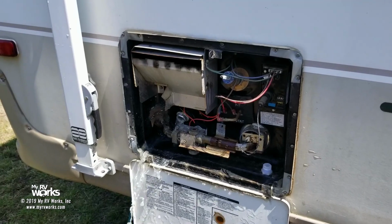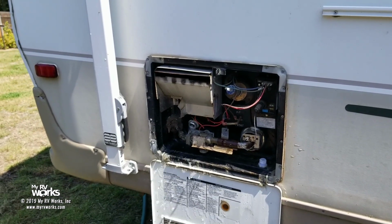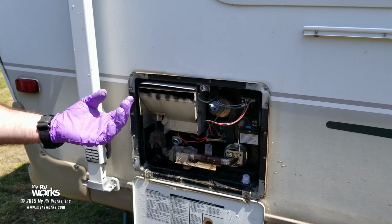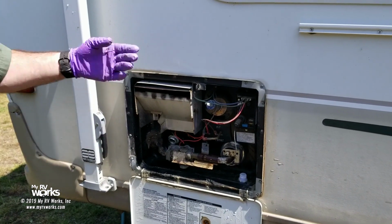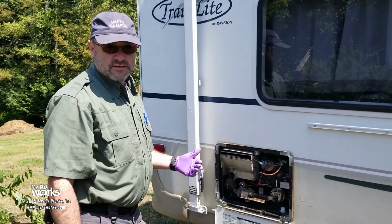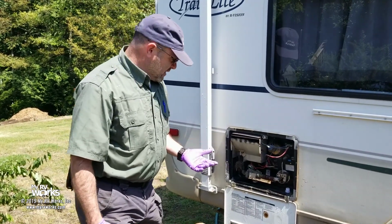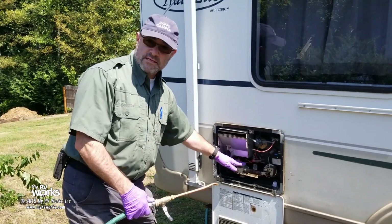Yeah, folks, I'll tell you this. The service call for this was because the toilet was not getting any water. And we came with a new valve, expecting to replace the valve because the valve had failed. When we got in there, we never even had to pull the valve because there was all this gritty sediment, not really mold from the freshwater tank, but like what we would expect to have gotten from the water heater, that had clogged up the toilet valve. So we cleaned all that out, and the toilet's working fine now. And that's what's led us to wonder, is it possible that the manufacturer connected the toilet to the hot water instead of the cold water? It's possible. And where'd the gritty calcium stuff come from that we saw in the valve of the toilet? And that led us to here. Since it's supposed to be done once a year and it hasn't been done a long time, that's what we decided to do, the backflush.